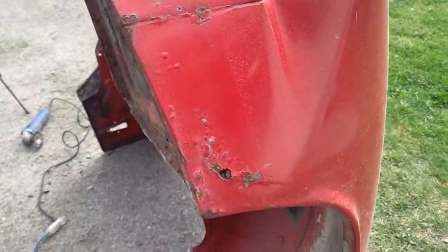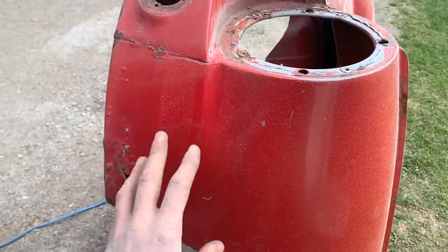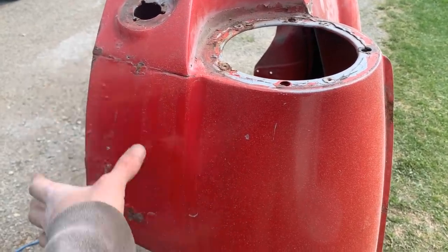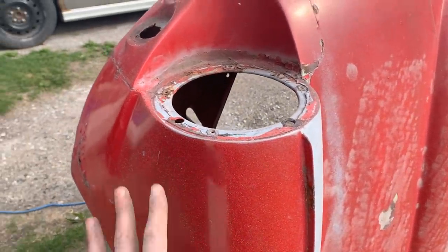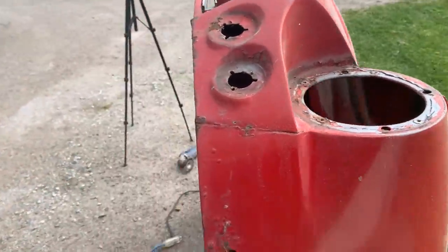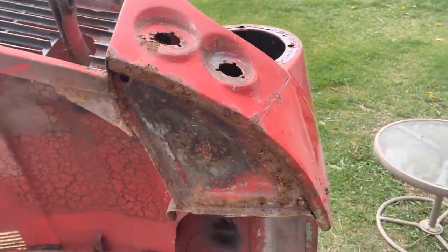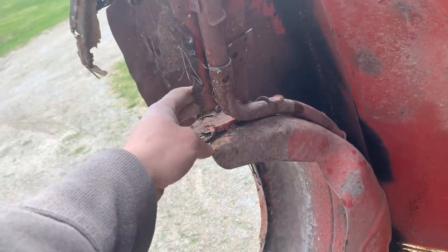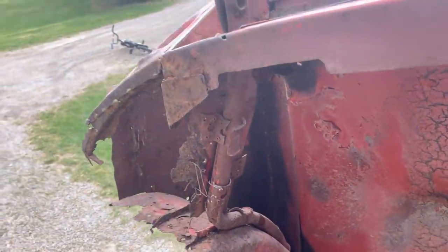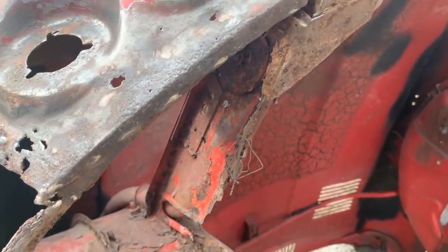The triangle piece is available to buy - that's fine. The inner fenders I can repair - I don't think we need new inner fenders, we can just extend and bring them to the correct length. I'm gonna clean this side as well and see if this fender is in a little bit better shape, which I believe it is. Maybe this fender will survive. But again there's a fiberglass patch inside which means something is going on, so we'll be able to tell once it's stripped.